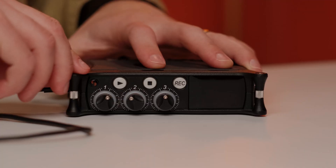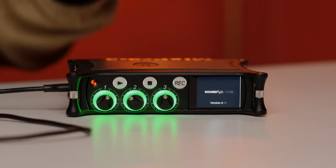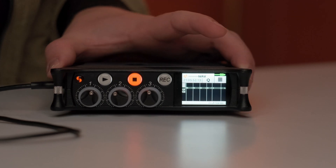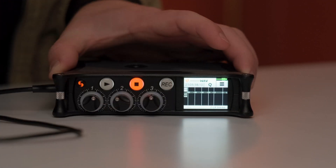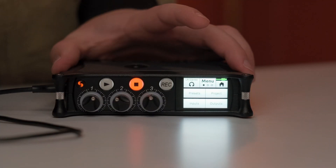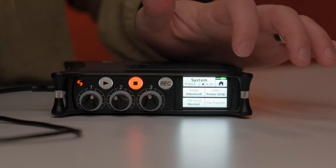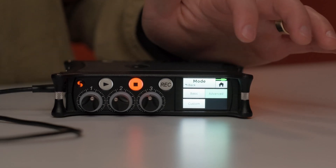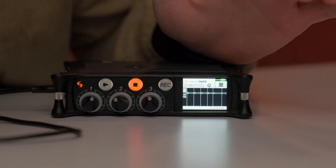Once you get this plugged in and ready to go, you're going to hit a switch right here — it's going to say 'on.' It's in a bad position, right under the USB-C cable. The first thing you're going to want to do is make sure that you're in advanced mode. Click this hamburger icon, scroll over to menu, scroll over twice to System, and then go to Advanced Mode — not Basic. Once you do that, it's going to reset every setting that you had and it's going to look a lot different.